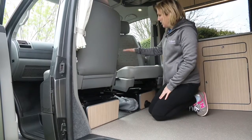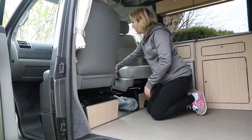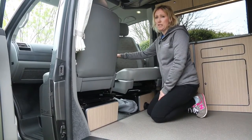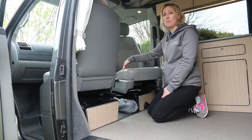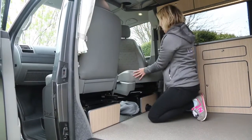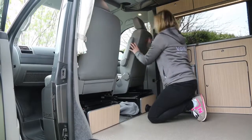With the driver's seat, if you've adjusted the seat up or down, make sure the seat's in the fully upright position, this armrest is down to pass under the steering wheel, and the handbrake is down so the seat will pass over it. Then spin the seat around and it will click into the forward position.